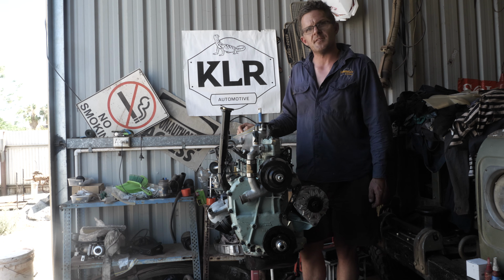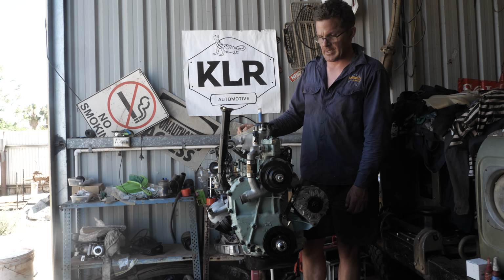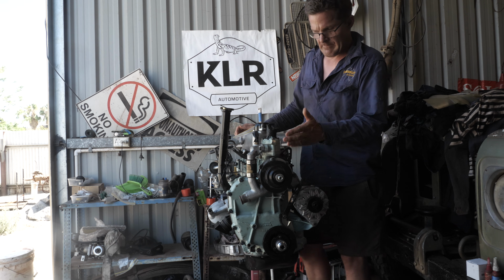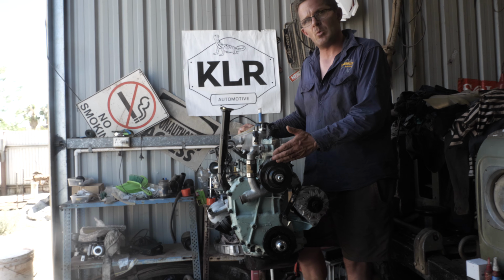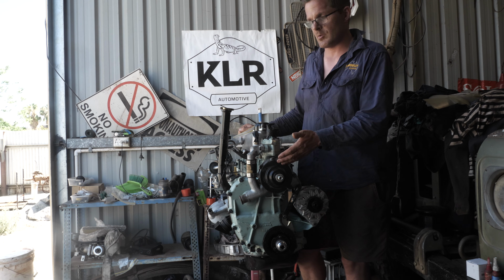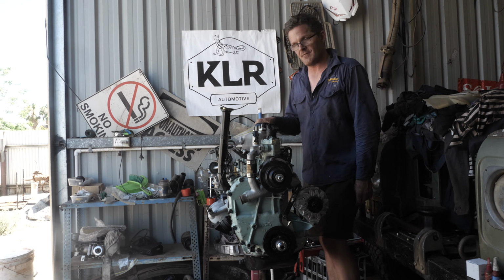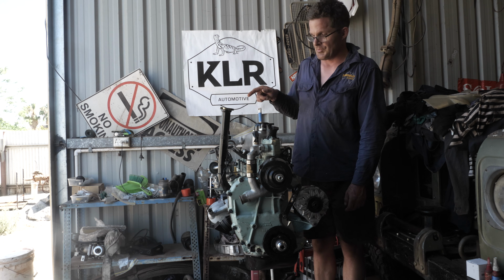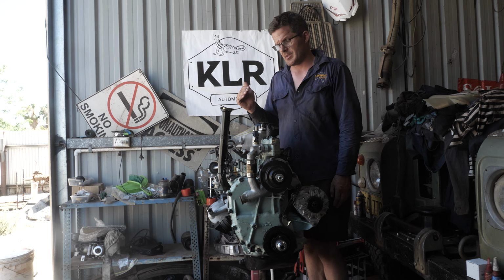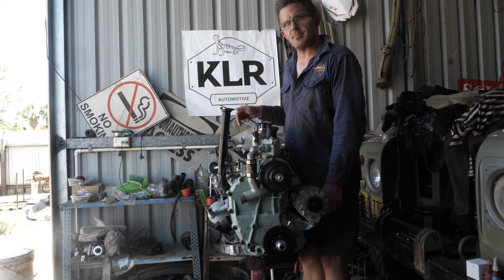By the time I found out this, and with the oil pump being so simple, and being a genuine part, the motor itself was completely dead. The big end bearing on the number one conrod had spun and had basically warped. Cylinder 2, 3, but particularly 4 was bad. There was scoring inside the bore. The camshaft was okay, along with the camshaft bearings, and the cam followers seemed to be okay too.